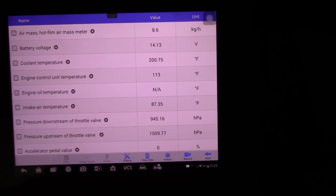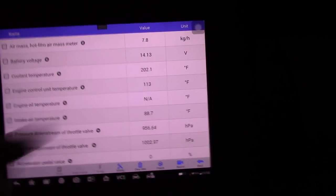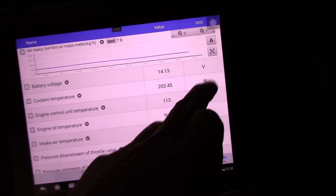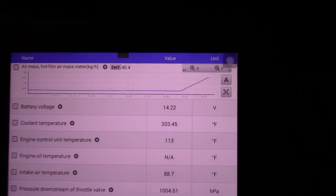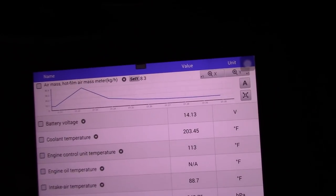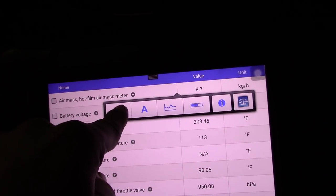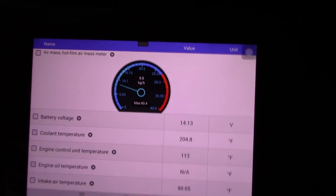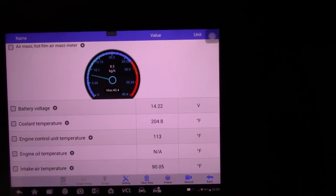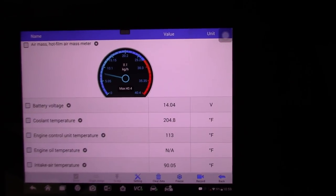We're going to have to check this vehicle again when it's cold. Let me do a very quick snap throttle to check the MAF value. It's reading about 40.4 — we need to do a unit conversion because I was thinking in grams per second and the scanner is reading in kilograms per hour. Using the gauge view to get minimum and maximum — right now reading 8.3 kg/hr at idle. So 40.4 might be good once we do that conversion.